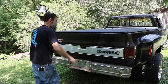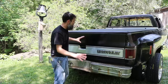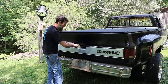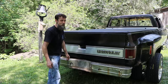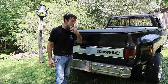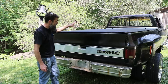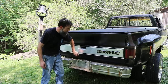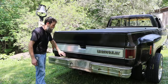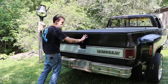So looking at this tailgate, you would not know it's actually 2 tailgates into one. The original tailgate that was on this truck was completely caved in up here at the top and had Bondo in it about a 1/2 inch thick. From this body line up, it was just ruined. So what I did is I took the old tailgate from my brown truck in the shop, the one that I rebuilt years ago. I cut the top off of it because it was in relatively decent shape, and I scabbed it on to the original tailgate that came with this truck because it was not rusty in the bottom. My original tailgate off the brown truck was rotted out in the bottom, and this truck was beat up in the top. So I just put this top on this tailgate,